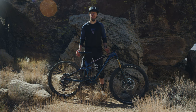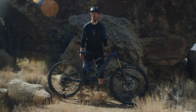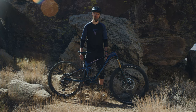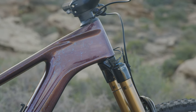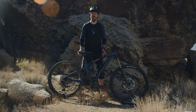The flip chip changes the head tube angle and the bottom bracket height — steeper and higher for more agility in tight cornering, and lower and slacker for more stability in more aggressive terrain. Because of the higher weight of e-bikes, even on one as light as this, the head tube angle has a huge effect on handling. We took a balanced approach, with 65.8 degrees in low and 66.5 degrees in high, which complements the agile and nimble riding characteristics of this bike.